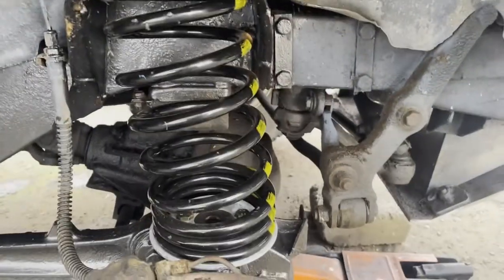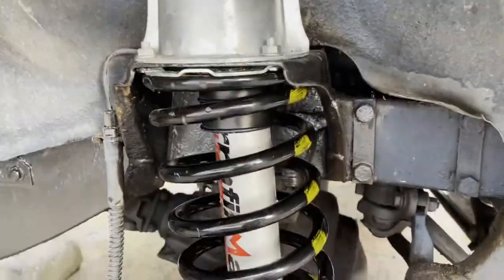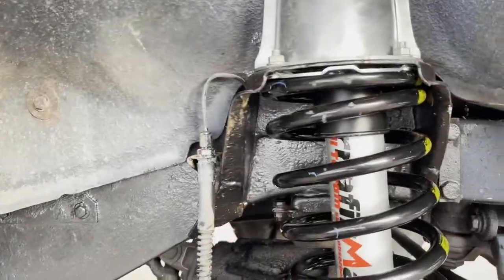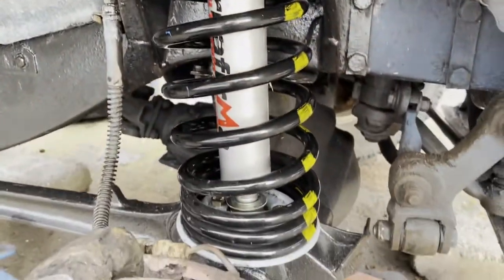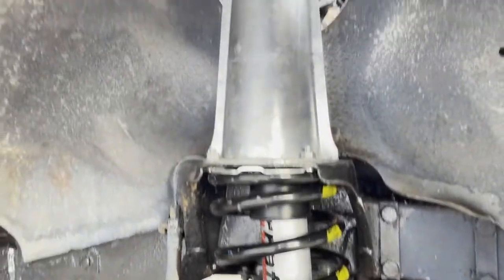Next job is to install the dampener with the turret. And that's it — once you've got your turret on, just fasten up the bottom nut with the washers, tidy up a little bit, put paint there, and put this cover back on. And there we go, that's it. Not really that difficult, just takes a bit of time.